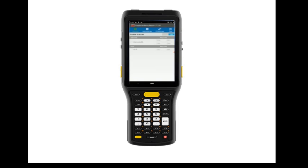If you're using the inbuilt scanner on the device, rather than the pistol grip, ensure the Barcode 2D checkbox is ticked. To tick this, disable the scanner using the slider next to the words Enable Scanner, then check the box, and then re-enable the scanner again using the same slider.